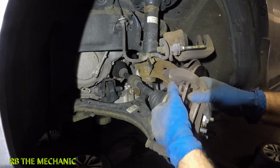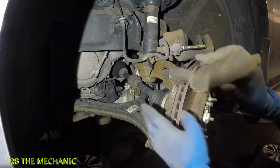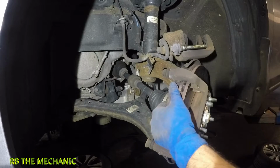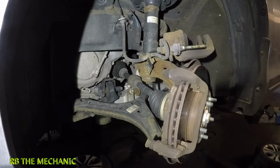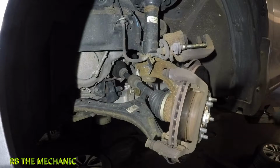You see this brake pad is jammed up. See, I can't even budge it. That's no good. That's a sign brakes are gonna wear uneven. So there's the brake pad I have. If it doesn't come out, you're gonna need a flathead screwdriver or a pry bar. Just stick it in there guys and push it out and get that pad out of there.